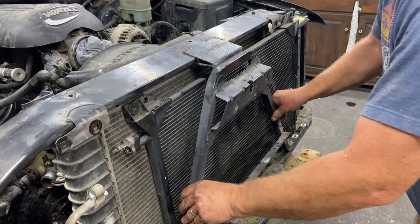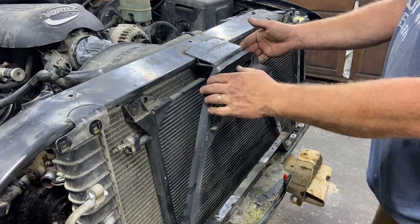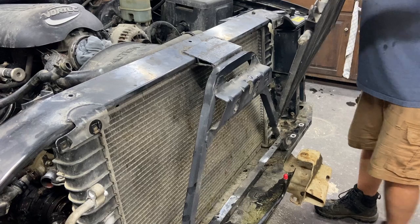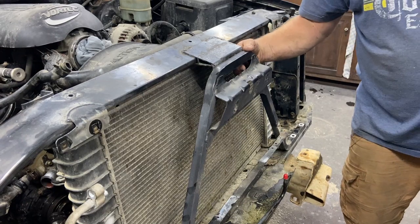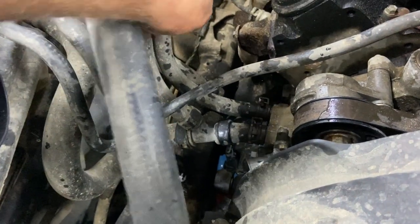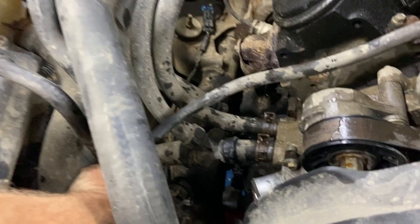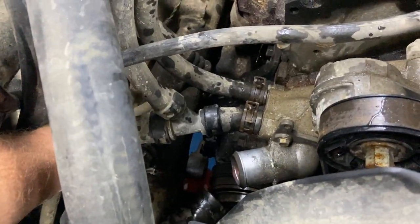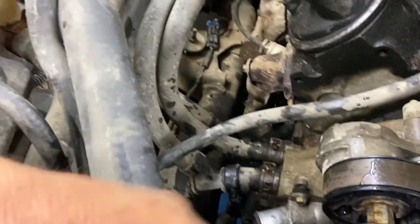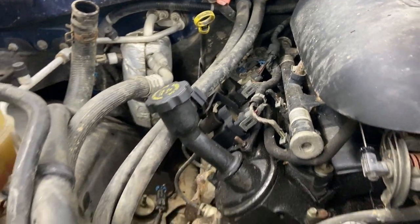We've got the pins out of the bottom of this bracket here, but it's welded to the support up top and bolted back here. So I disconnected the condenser and realized it'll just slide nice and easy out the side, and then we should be able to get to our bolts back here and get this bracket off. While we've got all this draining, I'm going to go ahead and disconnect the heater hoses and the return to the overflow from the water pump. It looks like we've got a Y right there for the heater hose — the bottom goes to the overflow and that one there goes straight back to the heater box. So let's get those undone and drain those as well.